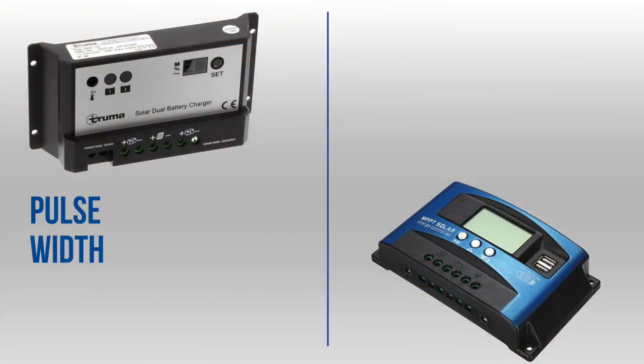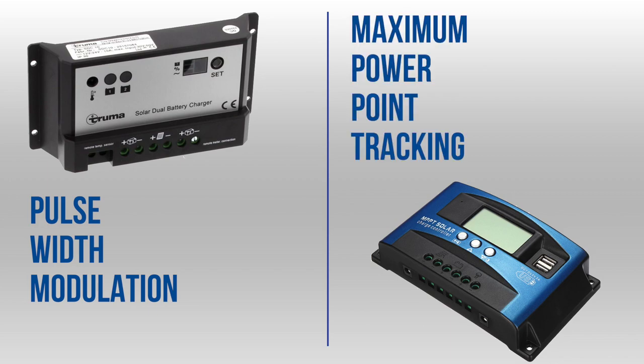There are two main types of solar chargers: PWM and MPPT. This video isn't about the differences or which one is best, but look out for that in a future video. Here's the caveat: you won't find a battery manufacturer in the world that will endorse a solar power system, because there are too many variables — from the style of controller to the weather to the quality of the components. Yuasa have advised me they've seen a worrying trend of damage and problems with batteries caused by very badly maintained or constructed solar controllers. So use a panel manufacturer you know and trust — personally we're using the Truma system. If you're interested in a solar installation, do your research, see what others recommend, and talk to a dealership or caravan engineer.